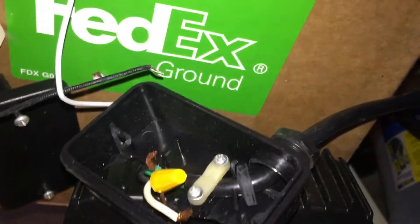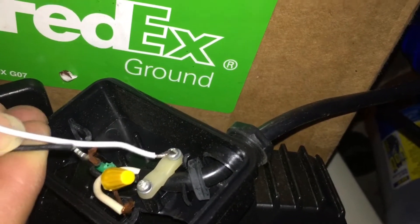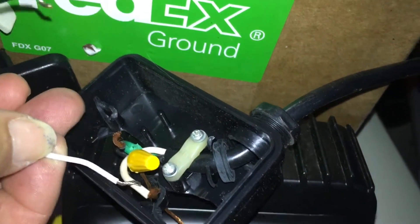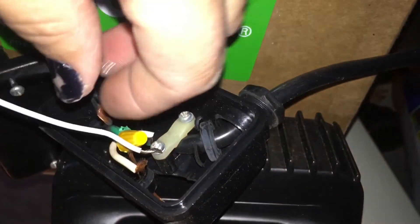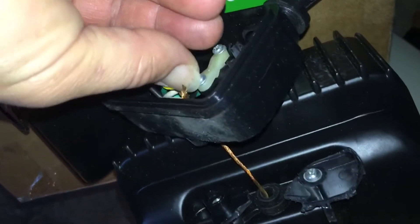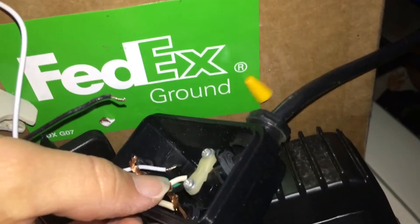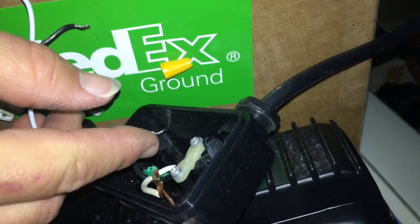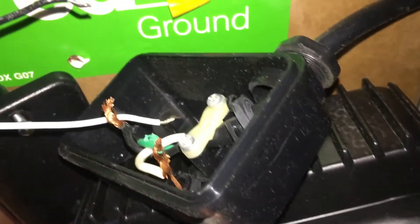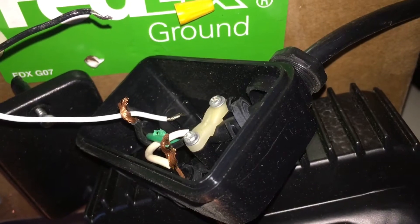All you have to do is disconnect these guys here. This goes through the housing and then there's a junction box in the back. All you've got to do is pull off the white and the black leads — they just meet up with the white and black leads coming out of the cord and are held together with these little household wire nut junctions. You don't have to remove the green — that would be your ground. Just take off your hot and your return power wires.